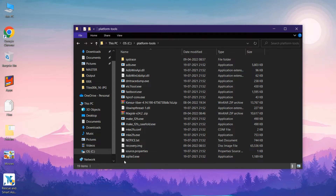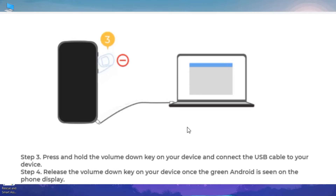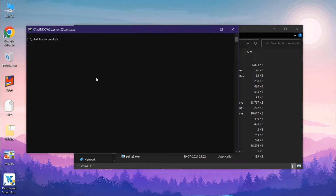To open the command prompt, hold Shift and right-click to get the option, then click on 'Open command window here.' Now power off your device, connect it to your laptop, and boot into bootloader mode by pressing and holding Volume Down for 5 seconds. To check whether your device is connected, type the command 'fastboot devices' or 'adb devices' — as you can see, my device is now detected.